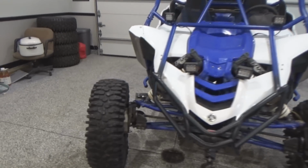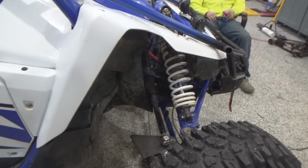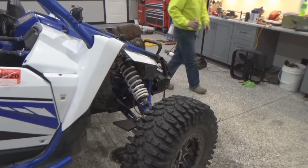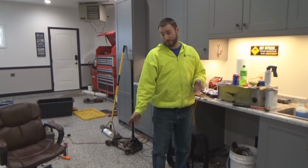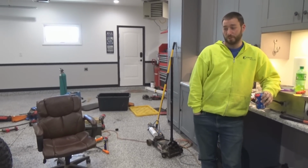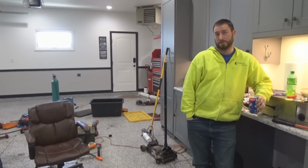So we're gonna pull apart this front steering and look at spacing the whole stock knuckle back a little bit, so that it would only go back like a half inch or 3/8 of an inch, and hopefully at least get rid of the hyperextending of the tie rods. It should give a little bit of feedback, there should be less. You should gain a little bit of leverage, but it won't be as dramatic as what we have here, obviously. It'll be like a third of what I have now, so hopefully it's the sweet spot.